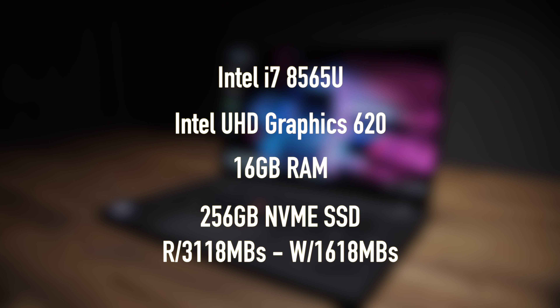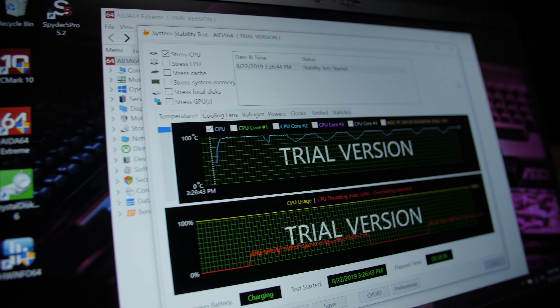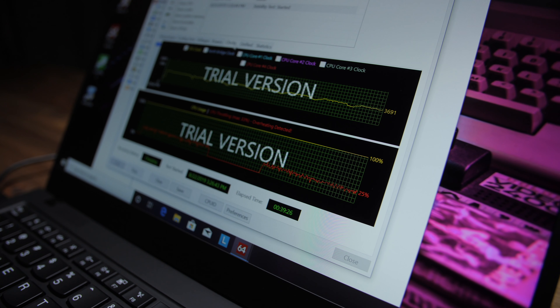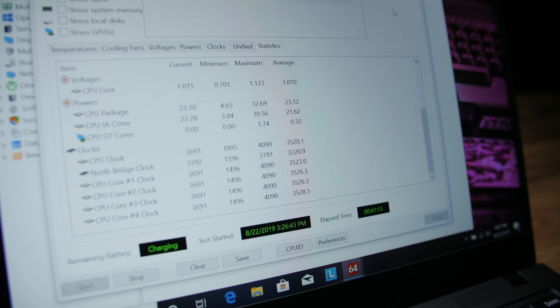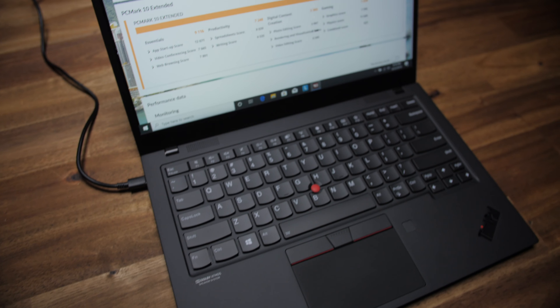Performance — I wouldn't say it's great, I'd say it's good. It's a very thin laptop with a single exhaust fan, so heat management isn't fantastic. Stress testing with AIDA64 causes thermal throttling right out of the gate. Clock speeds fluctuate — starting around 3GHz, climbing to 3.8GHz for about five minutes, then dropping back to between 3 and 3.2GHz — averaging around 3.5GHz. Average temperature under load is 89°C. That said, I doubt anyone will run a workload equivalent to a stress test with what this laptop is designed for.